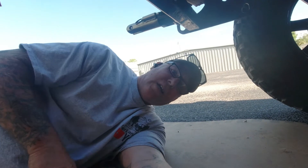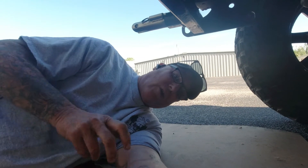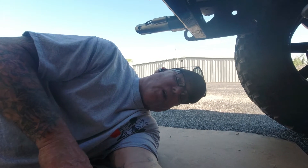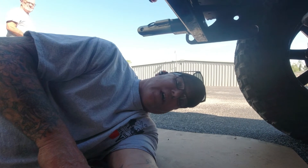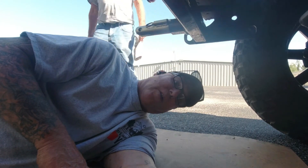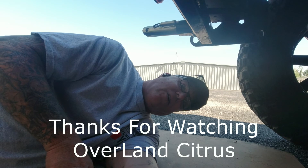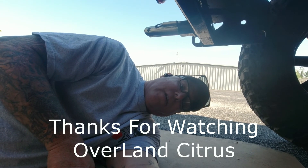We got them in. It was a little bit of a job — we had a bolt that was rusted solid and welded from the rust right to the bolt, so the sleeve from the stabilizer was stuck. We had to pull off the stabilizer bracket from the axle, take everything apart, bring it in the garage, free it up, and then put it all back together. But we got it done. There's nothing you can't do if you stay with it. Thanks for watching — don't forget to hit the button and subscribe. If you hit the little bell, you'll see all my new videos. And as I always say, wheel safe and camp safe. Have a great day.